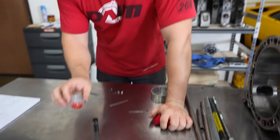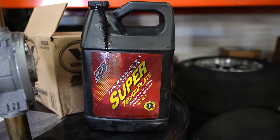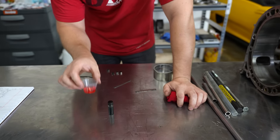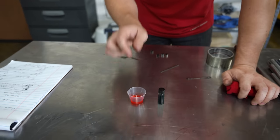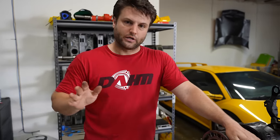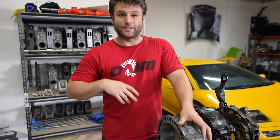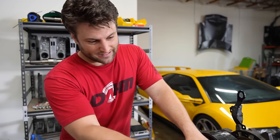So the second major thing I would do is use a two-stroke oil — an oil that is literally meant to be ignited, just like a weed whacker. This oil is designed to lubricate but also combust cleanly, much cleaner than regular motor oil. This stuff would suck as crankcase oil — it would never touch Valvoline for high RPMs. But for lubricating apex seals, pre-mixing with two-stroke oil, whether it's the stuff meant for gasoline or E85, is the second major solution to rotary engine reliability.